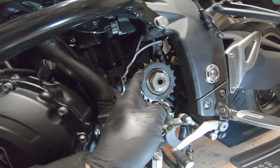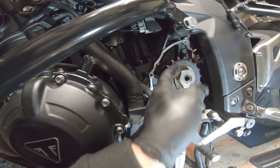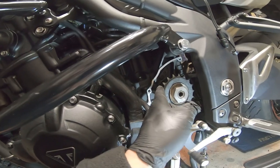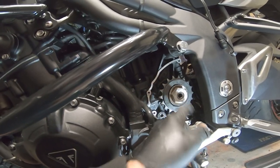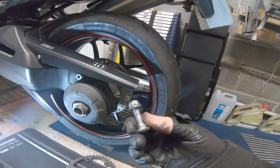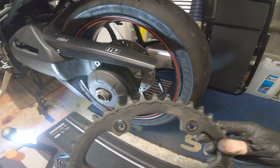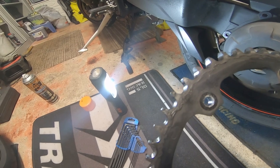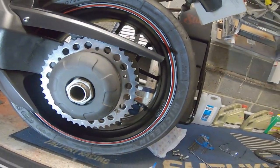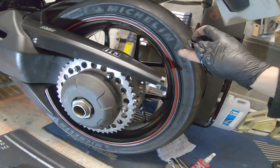That's the front sprocket back in place but not tightened up yet, just on there to make sure everything fits. I do have to remember to fold that tab washer over a bit. Next job is to check the rear — the sprocket bolts out and the sprocket just came off, and again looking at that it's definitely worn. These nuts need to be tightened up to 30 Newton metres. Right, sprocket on, all torqued up.